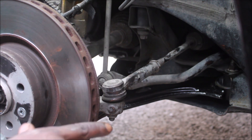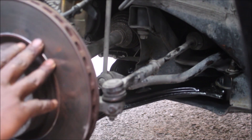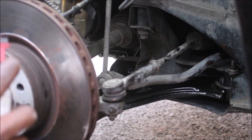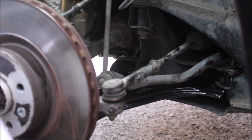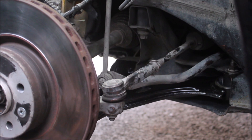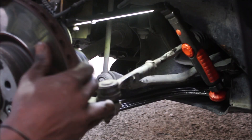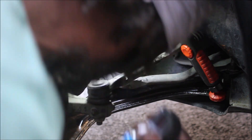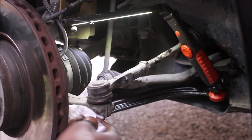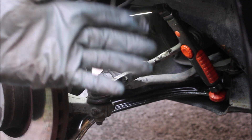This is how to install a control arm and I am done over here. I am going to clean the brake disc as you can see — we touched the surface with copper grease so it is dirty. Make sure you clean it or else you will have brake problems. I am using a brake cleaner. Now off camera I am going to install the panel, put the mud guard back and I am done.